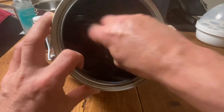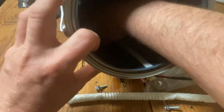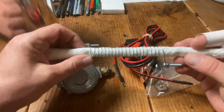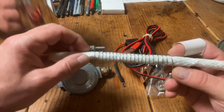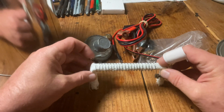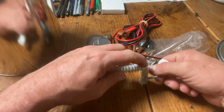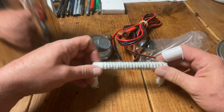So I went on eBay and found a fellow who actually sells a kit to make your own smoke tester. He sends it out in a one-gallon paint bucket with a lid. The best part is the heat element — he uses a resistive heat wire that draws about six amps at 12 volts. It comes with screws and is mounted into the end of a wick, so the wick touches the bottom of the container where you pour the baby oil in, filled up about three-quarters up the leg.